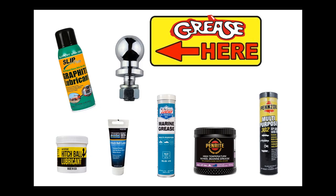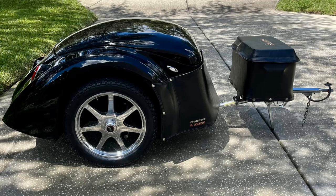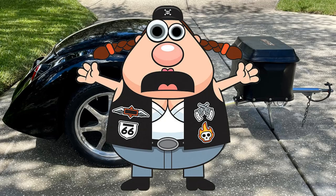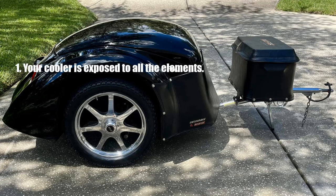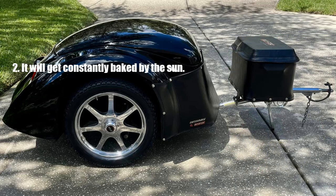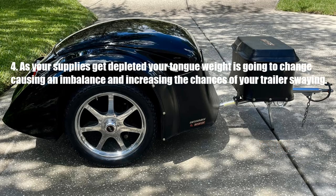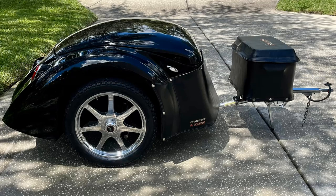Let's look at something that most of us have done — carrying a cooler on the drawbar of your trailer. There are some issues with doing this: anything you put on your drawbar will get very dirty from your rear tire, and this significantly reduces the amount of time your ice will last. If at any stage your trailer does begin to sway, slow down by reducing your speed gradually, then when you come to a standstill determine what's causing the problem and correct it.